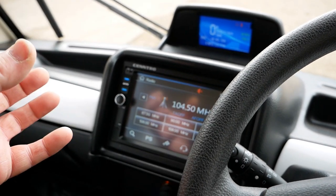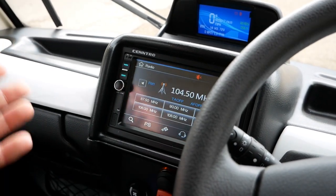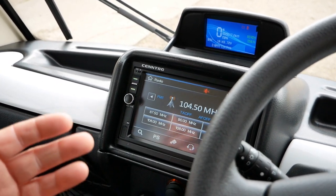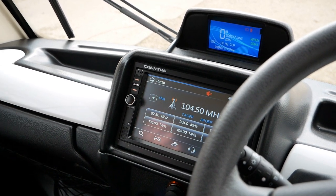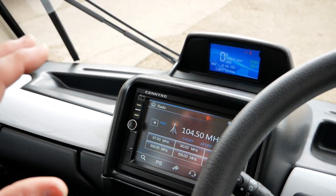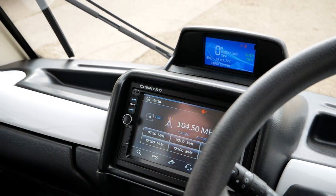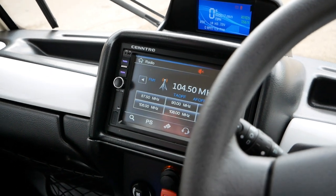You will however hear an electric pump — that's the brake servo pump pressurizing the brake system. You'll hear that pretty much every time you use the brakes; the pump will come on and pressurize the system again. It makes quite a bit of noise and at first you might think something is wrong, but it's only because there's no engine drowning out the noise. The brake grinding sound and brake pressure pump are completely normal.